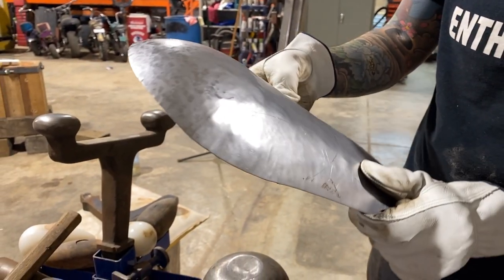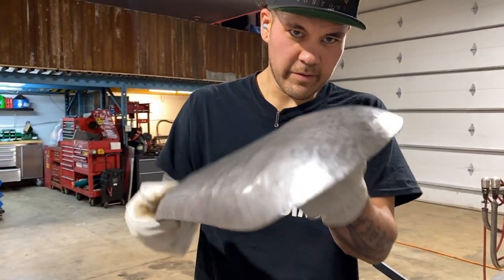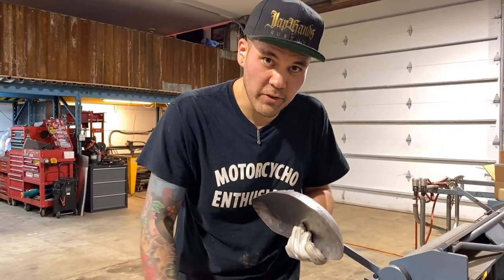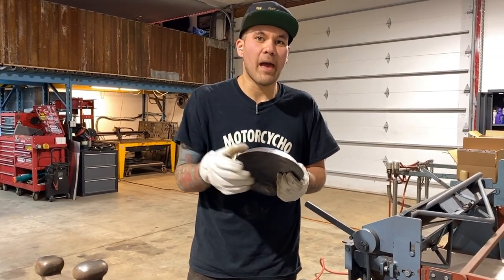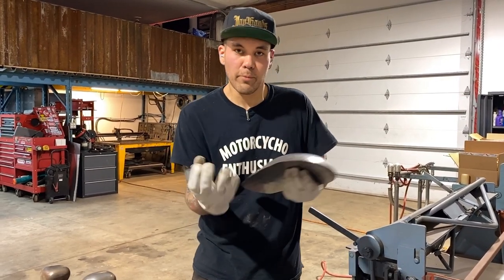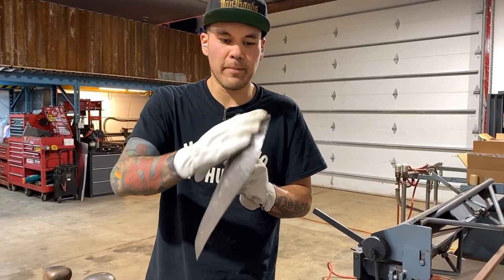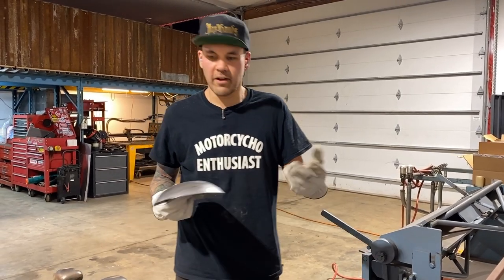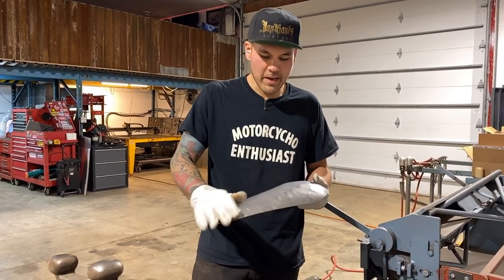You can already see how smooth that shape is coming out. It's kind of equalizing the highs and lows by doing a bunch of little taps. As you're feeling it on the dolly, you can feel when the hammer is hitting with something behind it or when there's a void — that's you hitting the tops of the highs, and the lows are getting pushed up around it by the dolly. If I took 80-grit sandpaper to that, it would already be smooth. We've been here for five minutes. I'm going to keep going and try to make this a pretty smooth shape.